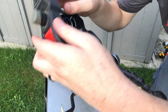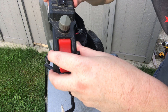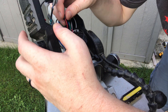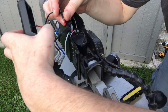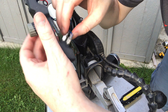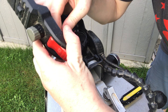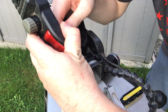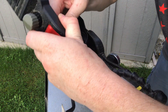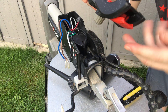There are two different relays: one for the switch or the control switch for the speed, and one for the light. I'm going to pull those off — there are two of them. The first one comes off, second one comes off, and then there are four connectors connected to the switch. I like to take a photo before you do all this just so you can see exactly what the correct order is when putting it back together.